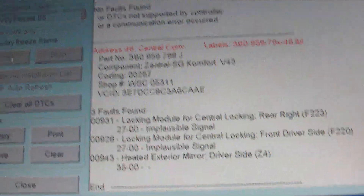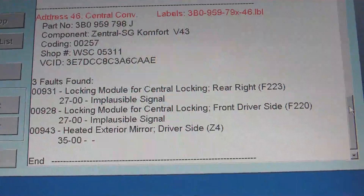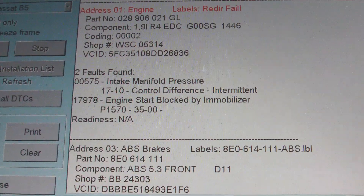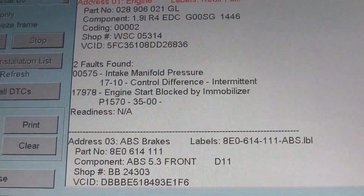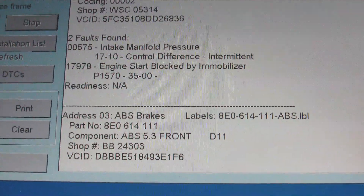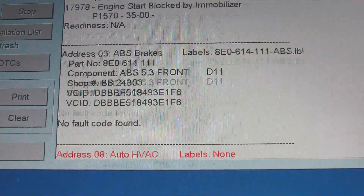So it's finished — it just went. Looking through here, the ones I had were airbag errors. We've got two errors there. Then you've got intake manifold pressure control difference. Engine start blocked by immobiliser — I might have to look into that one, because I think that's my battery. I'm sure my battery's dying, and that's possibly what caused it before. I'll have to check that one out, I might have to reset it.